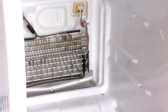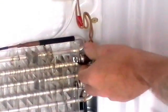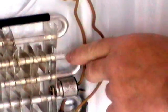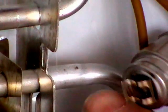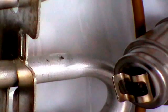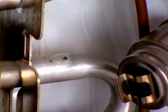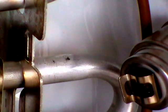We just like to point out the thermal devices. We'll unclip the top one and on this machine it reveals a problem. Where if you've got an RS-H1 that isn't working correctly and it's losing gas — we're just trying to focus on a tiny hole just there. That little hole there is caused by the thermal trip, the metal casing rubbing against the pipe during normal operation, and that lets all your gas out of the system.